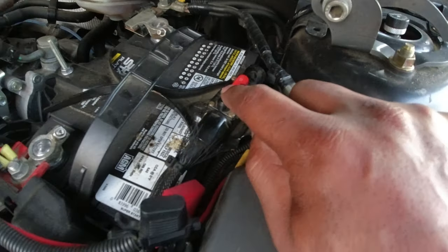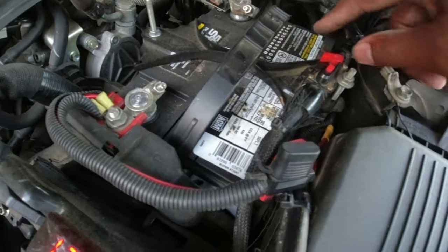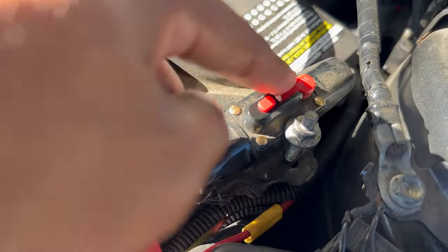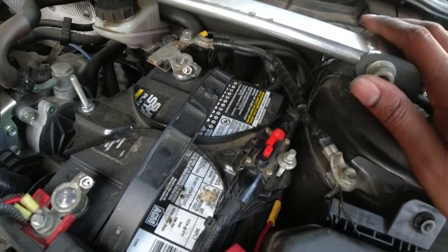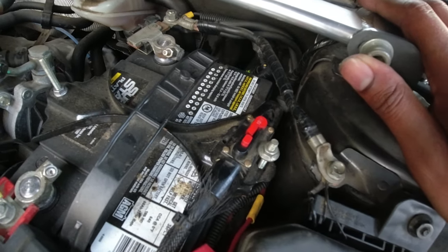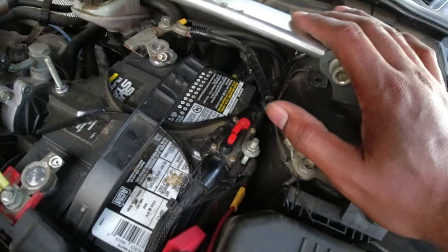If the car is hot, the internal spring gets hot, and then once it trips it won't catch again — it'll just keep going in and out. And today we have no bass because my circuit breaker doesn't want to circuit break, it just wants to break. So if I'm on a road trip, two or three hours, it gets hot, the bass hits a low note and it trips — then I have no more bass for the rest of my trip.